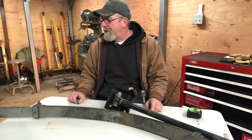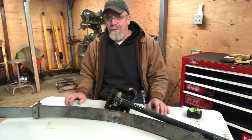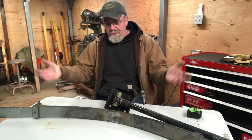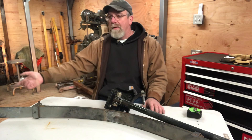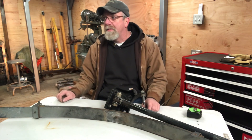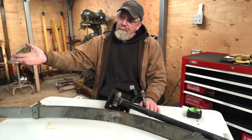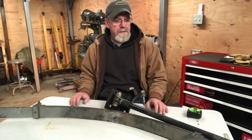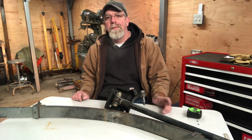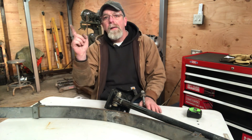So I may end up turning some aluminum ones on the lathe and putting them in there. My rear end is currently down getting some work done, so I thought I'd go over this now. It was a cheap way to do it — a hundred bucks — and great traction. Last season I was pulling the left front wheel on the S10 up six to eight inches every single pass; it was just hooking really well with this system. My problem now is it was doing that too much, so I've got an anti-sway bar I'm going to put in the back and a whole bunch of upgrades. We'll go over that later. This is how I did it for cheap, and you can do it too. Thanks for watching, thanks for hanging out, thanks to the new subscribers and all my old subscribers. Stay safe — I'll see you next time.